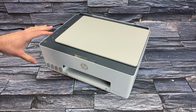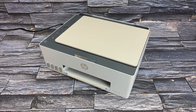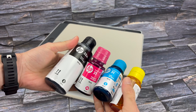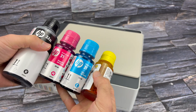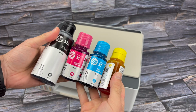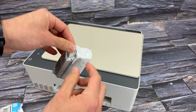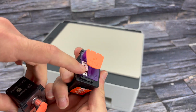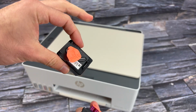Now let's go ahead and install the ink in this printer over here in the ink tanks, and also how to install the print heads. First thing obviously is to remove them from the packaging. This printer takes the HP 32XL black ink, and for the color ones it's the HP 31. I'll put links in the description if you want to get some replacement ink from Amazon. Let's open the print heads that come in this package. The magenta top print head is for the color ink and the black one is obviously for the black ink.